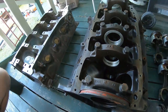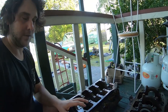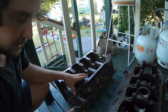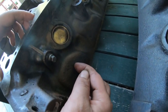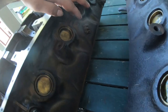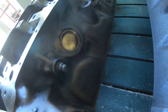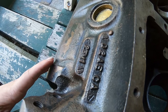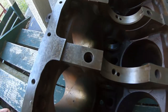They ended up doing a third version — the pillow block. What they did to strengthen the block: because all Clevelands are thin-wall casting technology and there's not a lot of metal in the blocks, they put these bulges on as large as they could go without interfering with any exhaust in the cars, to increase the water jacket volume on the inside underneath the metal. So they put these pillows on — one here which is beautifully defined and clean, this one also has the unique number on it, then one here and one here. The casting number on this is D2AE, so technically this is not a NASCAR block — it's just a pillow block. If the prefix were XE, then it would be a NASCAR block.